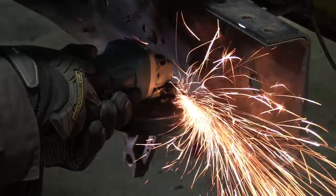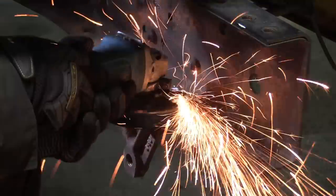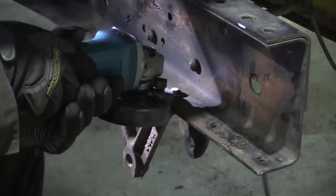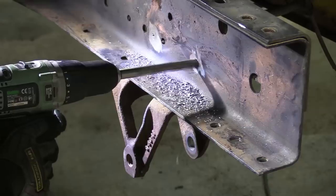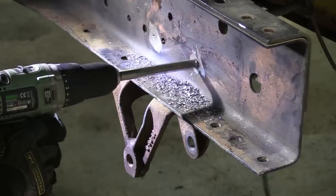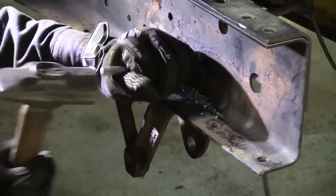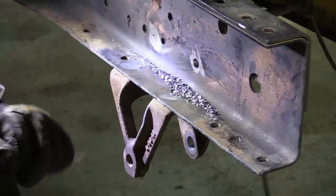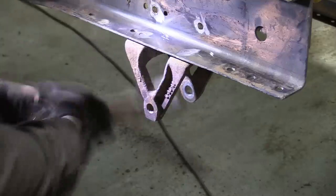Thankfully, everything on the DAF was bolted on, so it was easy enough to get off with the use of impact drivers, spanners, and the odd massive breaker bar. On the cargo, however, the spring hangers and all the important fixing points are riveted on, which means grinders, drills, and punches. Oh, and hammers. Lots of hammers.